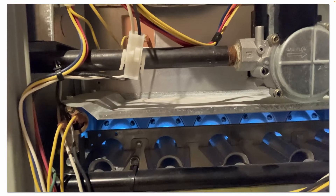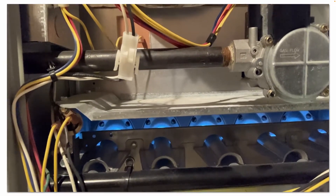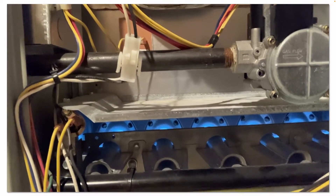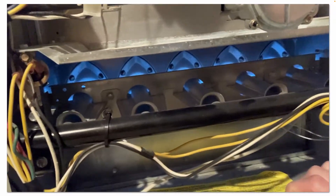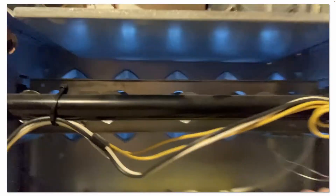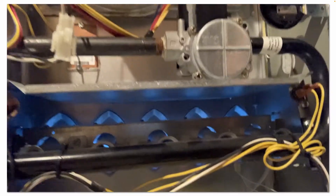But what's been happening is after about 20 seconds or so, the burner shuts off. Then the control board starts to restart the process again and the burner shuts off. Then it starts to retry the ignition again and it shuts off. So it's short-cycling.